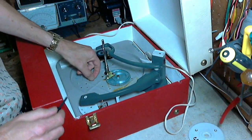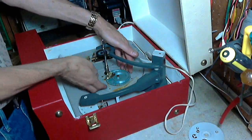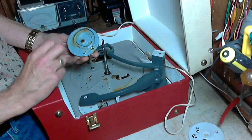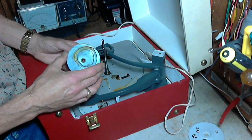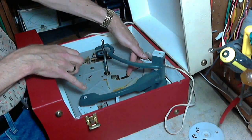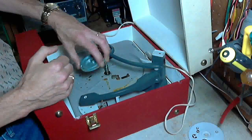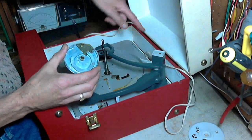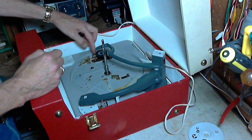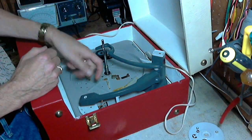There we go — and it didn't go flying. These clips tend to go flying when you take them off. In some cases getting this off is really difficult, but this one's easy as can be. I think somebody's done maintenance on this — actually no, I don't think it has been maintained. So this piece here moves back and forth and moves the arm. That piece is moved by traveling in this slot as this wheel turns around, and the wheel is geared to the platter and into this gear here. The little motor spindle is spinning this wheel, driving the platter, which drives the mechanism, which drives this. There's quite a gearing ratio there.